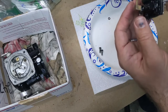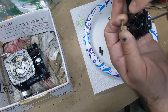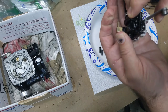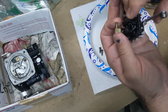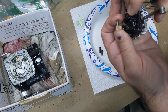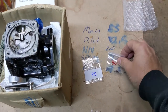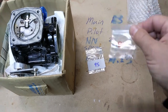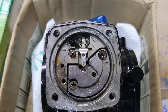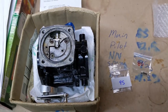This is easy to test: just hold your finger over it and squeeze the little thing down, and then you should feel a little pressure. My 80-gram springs arrived — so I'm going to take out the 95-gram here and put in the 80-gram, and we're going to retest the pop-off.